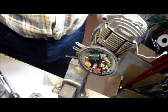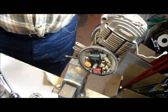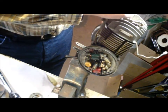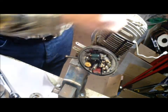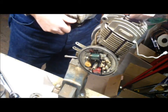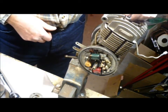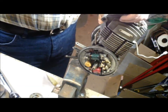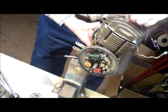We are going to take our piston stop tool. Put the piston at approximately top dead center. Put a screwdriver in there to see where she is, if you can't see down there because it is all carboned up or whatever. Just get her up to the top and thread in your piston stop tool. Move your piston up and down until you are sure that you are at the spot where it is actually touching.